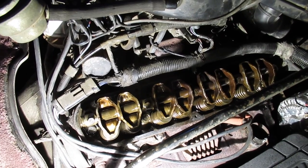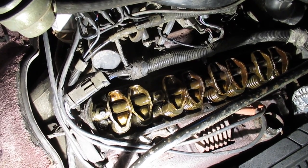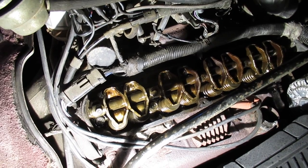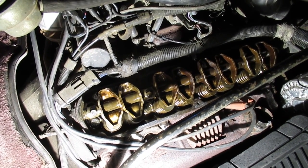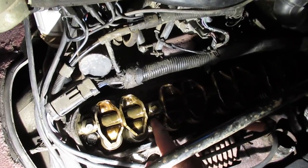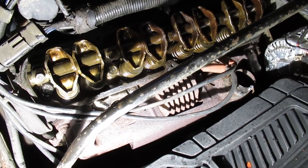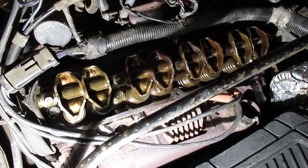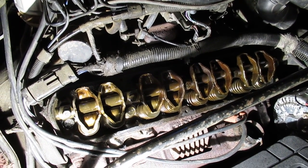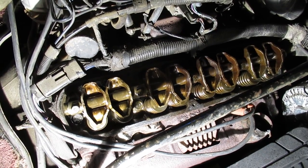Got things torqued up to 200 inch-pounds. It's right at the limit for the little quarter-inch torque wrench, so you should test it on something else first to make sure it works at that setting — you wouldn't want to snap off a bolt. I actually did that once where the torque wrench wasn't reacting well at the outer limits, and it cost me quite a bit of time and money. The 20-minute bleed-down time won't be a big deal — it'll take me that long to get the valve cover back on, torqued, the engine bay tidied up, and the doghouse back on. I won't really know if it's a success for 5,000 kilometers. Thank you for watching.